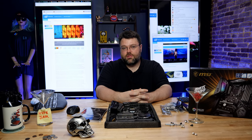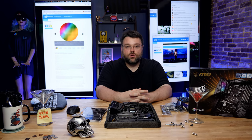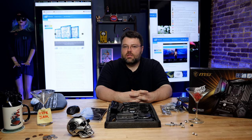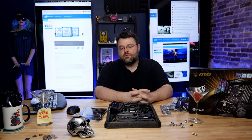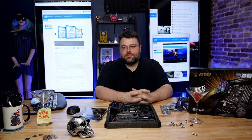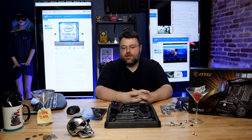I've got some DDR4 4000, and when I get an i9 CPU, or maybe the i7 8-core 8-thread CPU, we'll do the tests at 4 gigahertz versus 2666 and see how it stacks up. Historically, Intel CPUs haven't really benefited from dramatically faster memory, but I'm going to predict, again with no inside knowledge, just a guess, that the new CPUs are going to take better advantage of faster memory than previous generation CPUs have. I think that's going to turn out to be true, because when you've got 8 cores that are as fast as they are, it is going to take a lot of other horsepower to keep those cores fed.